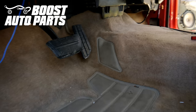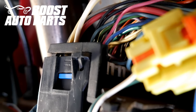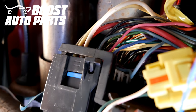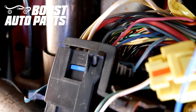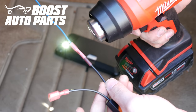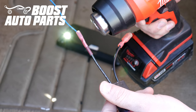Now to tap your signal lights, come into the driver's side foot well. When laying next to the brake pedal you'll be able to see a black connector — look up the right side and you'll see a dark and light blue wire there. Dark blue will be your turn signal for the right side; light blue will be for the left side. They are also pin A6 for dark blue and pin A7 for light blue. Go ahead and cut your signal wire and strip off the end. Be sure to pay attention to which side is driver's and which is passenger's, as it is crucial as to where you tap. Crimp the butt connector, then heat it up if you use Boost Auto Parts taps — if you use your own, splice in just like before.